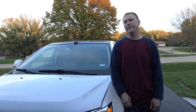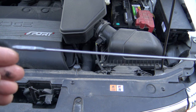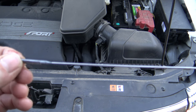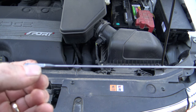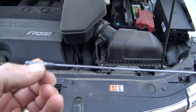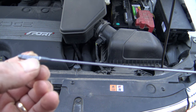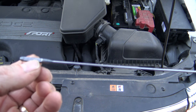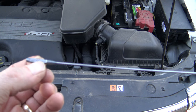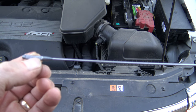When you come back from your test drive, leave the vehicle running — we're going to check the fluid with the engine running. If you look at the bottom of your dipstick, it's going to say 'check hot,' and if you rotate it around it will say min and max. You want your fluid level right in between. If you're a little low, add about a quarter of a quart at a time, do the same gear sequence, drive it around, and come back to check the level. If your level is correct — which it should be since you put back exactly what came out — go ahead and reinstall your fill cap and you're good to go.